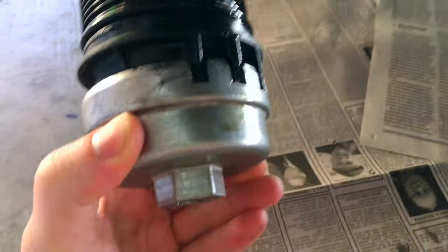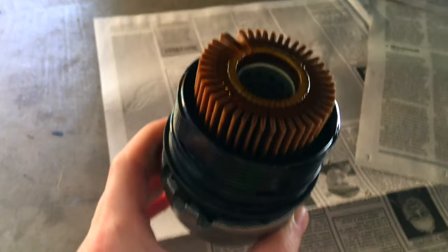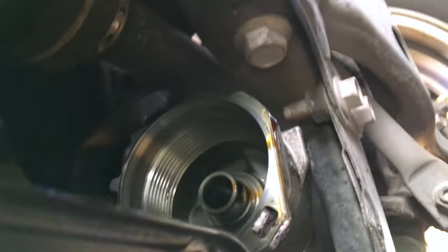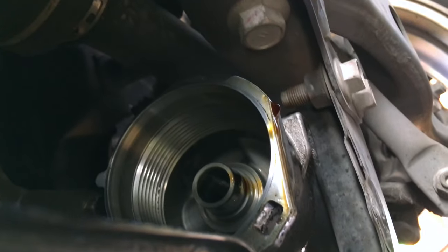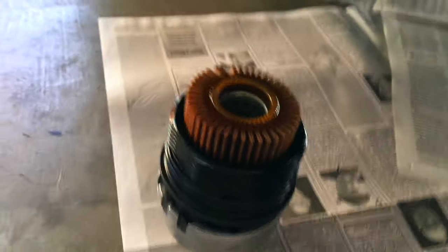This is the oil filter in the plastic oil filter housing and the special adapter tool that's required — that's a 3/8 connection on there. When this thing is installed in the engine it is so hard to remove — I had to resort to using an impact wrench. I had to set up my air compressor. Then to make matters worse, as soon as you unscrew this thing from the housing — the housing is mounted sideways right there — as soon as you start unscrewing it, oil starts pouring out, like six, seven, eight ounces of oil still dripping off. Make sure to put an oil pan under there.